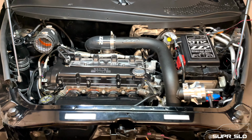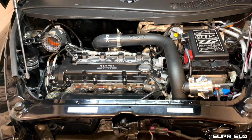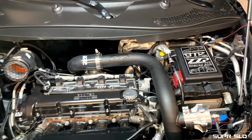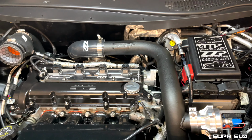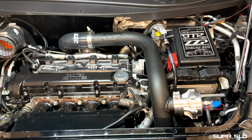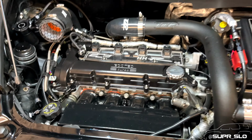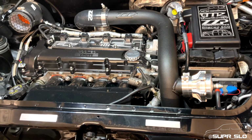All right, so able to check everything out, and this isn't as bad as I thought it was. Obviously, when I was driving, I was logging the car. I went into panic mode because I was at half throttle, hit about 30 pounds of boost, or what I thought was 30 pounds of boost, and then heard a giant pop and lost everything. So limped the car home, checked, didn't notice there were any leaks anywhere. So decided, all right, let the car cool off and check it out.